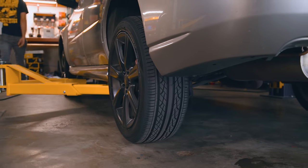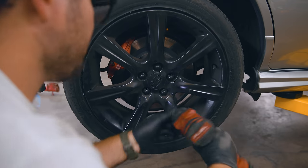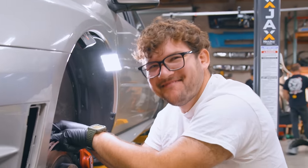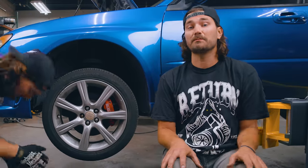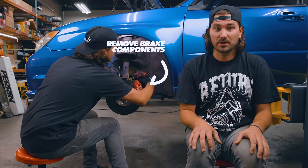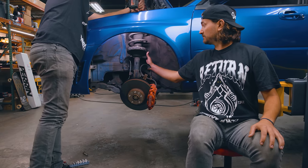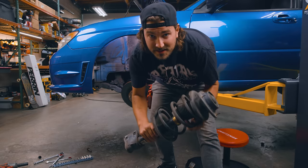Here we are again — high, low. This is a pretty familiar position we're in right now; we've done coilovers on a few different cars. Pretty standard stuff. All we've got to do is blast off these nuts. Upgrading your coilovers is something fun and easy you can do in usually just a day with some basic tools. Remove the wheel, remove the braking components from the suspension, disconnect the lower mount, disconnect the top mount, and the coilover's ready to come out.